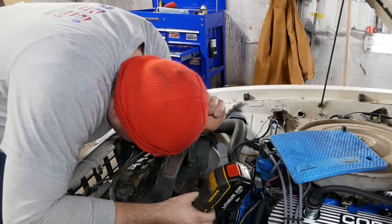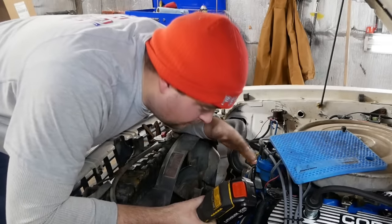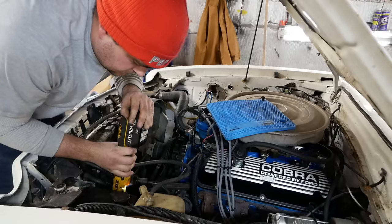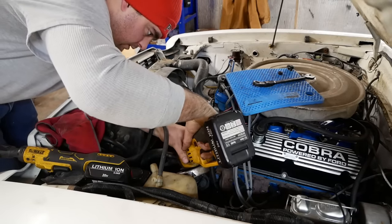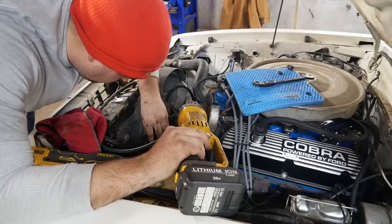You know the power steering pump was missing two bolts? That was probably why it was wandering and wobbly all over the place. I'll be damned. How about that? The fitting on the high pressure line is stripped out on the pump, so we'll just delete it out of our way instead. Thankfully it leaked, so hopefully there's not a whole lot in it.